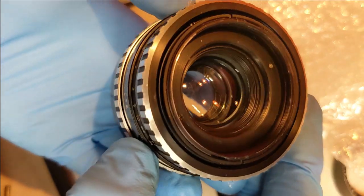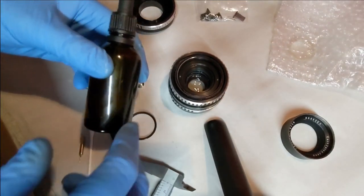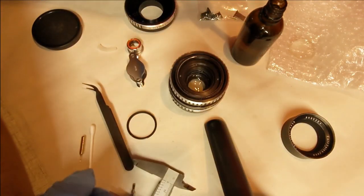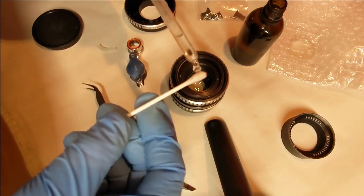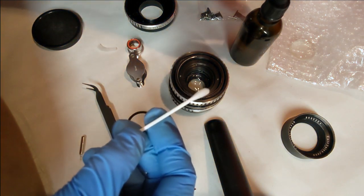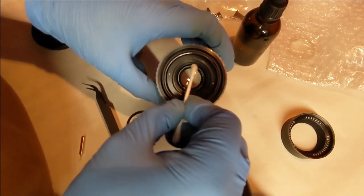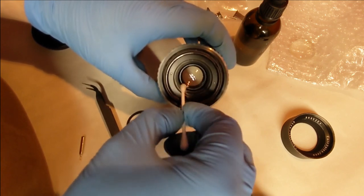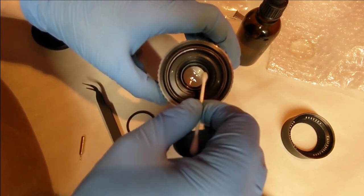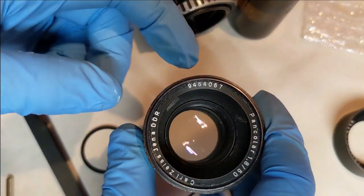The inside lens looks quite clean. I'm going to use hydrogen peroxide — just water and 3% hydrogen peroxide — so it's very weak but strong enough to kill any fungus. Sometimes you might need alcohol wipes or something stronger if there's oil or other debris. Generally I think for dust and preventing fungus this is great, because sometimes you can't see fungus growing at the edges. I'm not going to take all these lenses out — just saturating it with hydrogen peroxide so it seeps into the corners and kills any potential fungus.